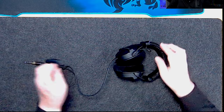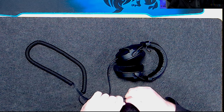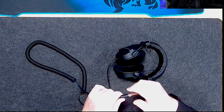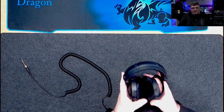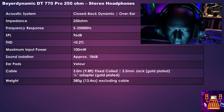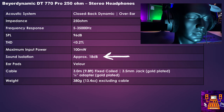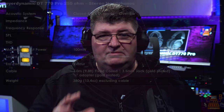The 250 ohm version comes with a coil cable about three meters long, so plenty of room there. It has a 3.5mm jack, which is pretty standard, but there is a quarter-inch adapter so you can use it with a lot of devices. Overall I would say the build quality is very good and you can expect them to be durable for a long time. They're a 250 ohm headphone and I haven't found any issues driving them for most audio interfaces, but some users do prefer to use a headphone amplifier. Their isolation is less than you would expect — only about 18 dB — quite a bit less than many other studio headphones I've looked at, but certainly usable in many applications.